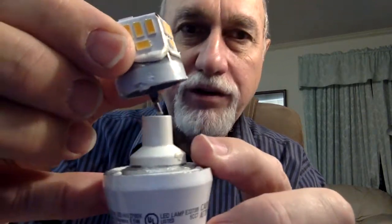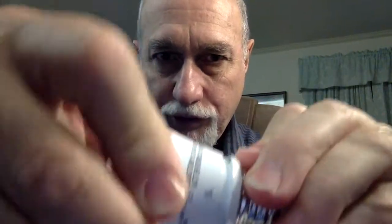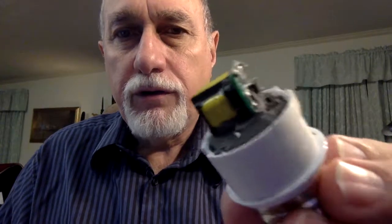I had to take the base apart to find the circuit itself. It turns out this piece is actually a bayonet fitting — you can just turn it a part of a turn and pull out, which if you're looking at the top would be anti-clockwise. Inside you find a fairly classic-looking circuit board with a little transformer. This has a circuit which presumably has a rectifier to convert to direct current, and they usually have various filtering systems to filter out radio frequency signals that might be emitted, producing a direct current to drive the LEDs. That's about it.